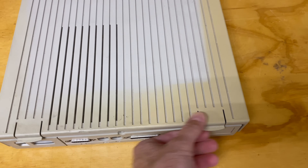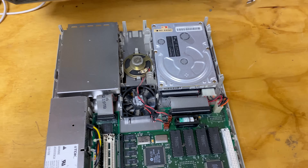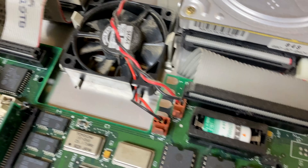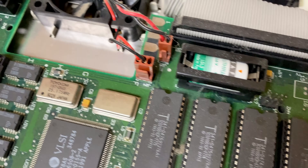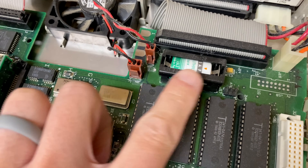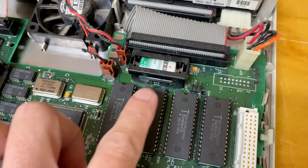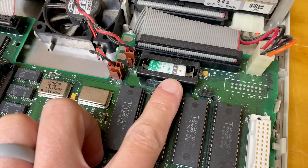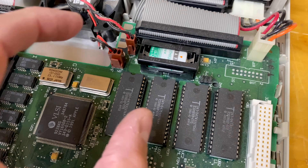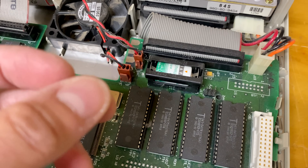So I very gingerly popped these tabs that hold the cover on and then you hinge it forward — I just want to see if there's any obvious damage in here that we need to address. The fan's a little dirty and that's kind of to be expected, but the big thing is this battery has not blown up yet. That's going to be coming out right away. These batteries, especially in these earlier machines from the late eighties and early nineties, have a tendency to literally explode. It's kind of the same thing as what happens with electrolytic caps — pressure builds up inside them and then they start to leak out. The thing with these batteries is they don't normally just leak slowly.